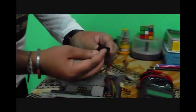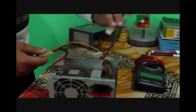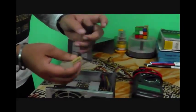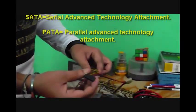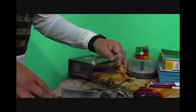If you have a SATA device — a SATA hard disk or SATA CD drive — here it is; this connector is for SATA. Both PATA and SATA connectors are available. If your SMPS is very old and you don't have any SATA connectors, you can get a PATA-to-SATA converter wire from any computer shop, which connects to the PATA wire and converts it to SATA.